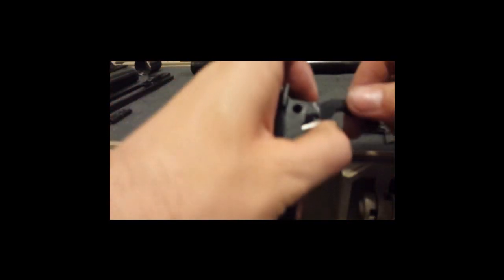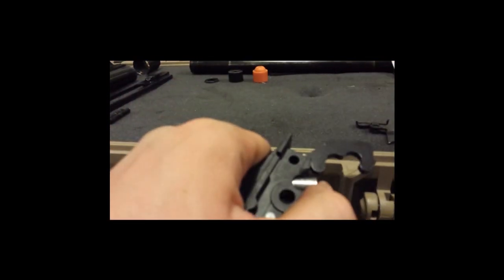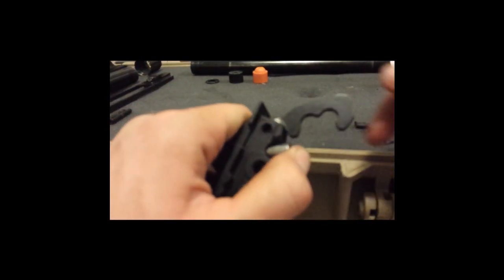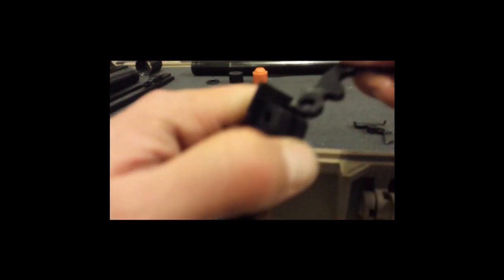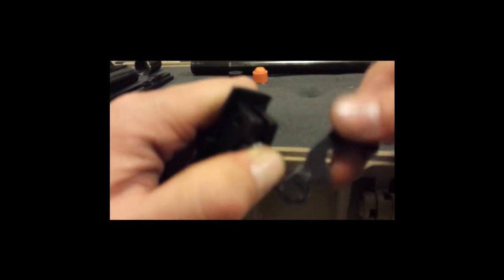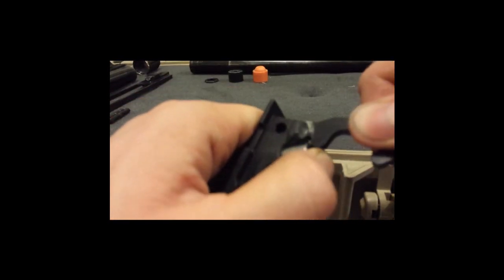It helps if you start this out in the right position. Go ahead and compress that down a little bit and get this on top. Okay, so we're going to start over. Do not put it in like this. That is wrong. You can't rotate it. The plastic has an indent here in the top, in this groove down here, that won't let the corner rotate past it. So don't force it, you'll break it.